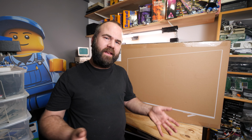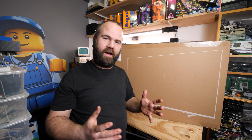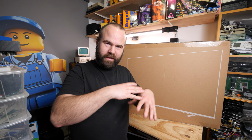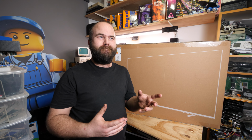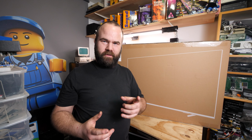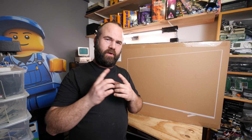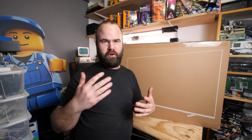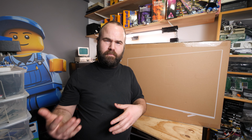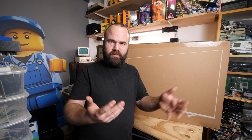It's a few days later now and the internet is working. But I filmed more of the menu and how I set it up, and then I found out that the modem with the new update has some serious bugs in the whole network stack. So the whole point of setting your own IP address was a bit pointless, because I couldn't set the subnet mask. It only accepts a /24, so 255.255.255.0. If I do anything else, it just won't accept it and doesn't save it. So there's a bug in it, because why should you only use that?